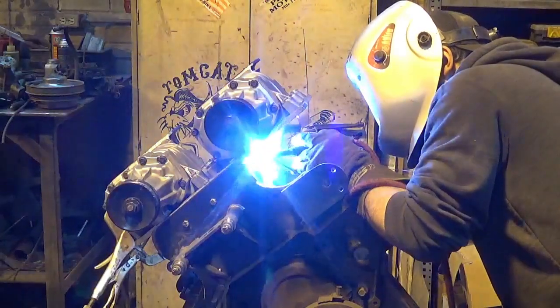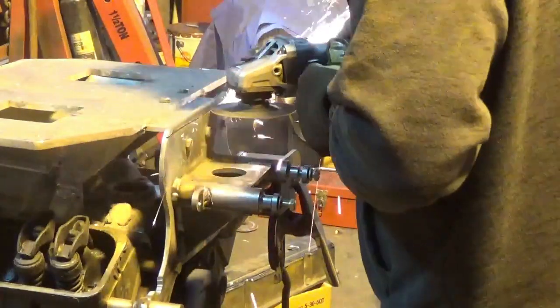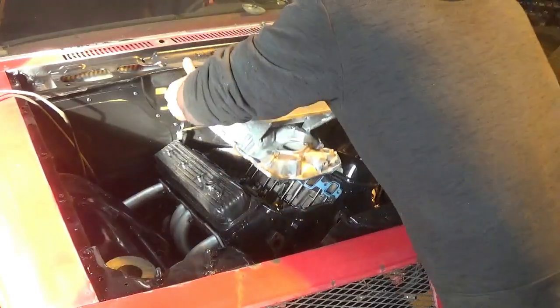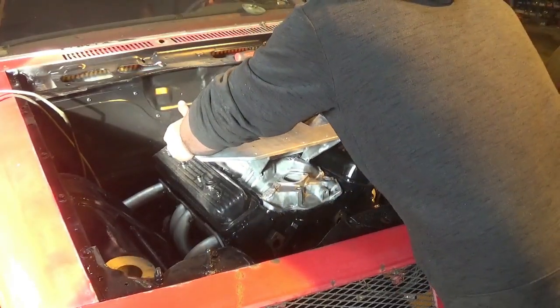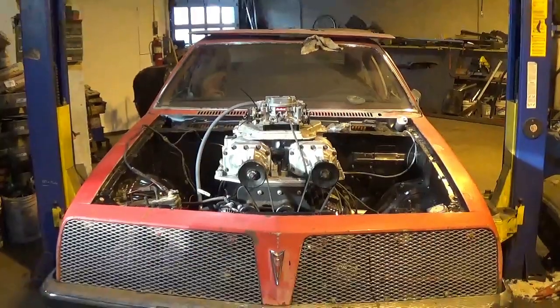Welcome back to the shop everyone. It's been a long couple of weeks. We've made a lot of progress on a few projects here, but tonight we're going to do something a little fun. We're going to try to start the twin supercharged engine. I did a bunch of small stuff on her over the last couple of weeks - finished welding up the bottom of the intake, removed all the pulleys and all that stuff, got everything trimmed down, ready to go, got a coat of flat black Rust-Oleum on everything, basically reassembled everything, glued the intake back on the engine, made some gaskets for the bottom of the blower plates, and we are pretty much ready to see if this thing's going to run, and we're going to do that tonight.